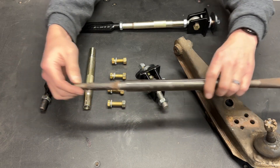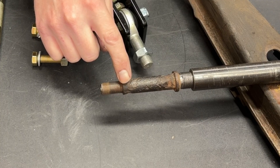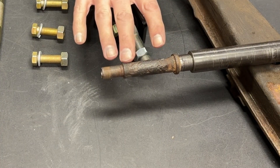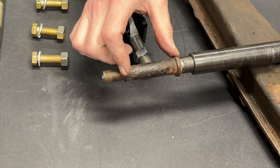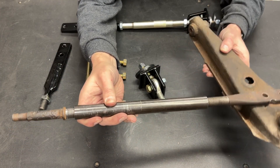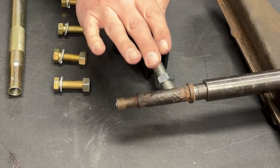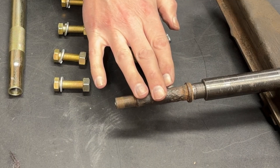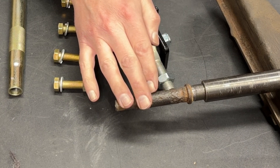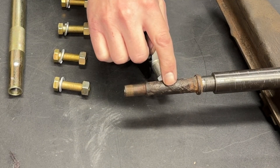The way this works is pretty simple: it bolts solidly to one end, and the other end has a machined surface that normally doesn't look so bad — this strut rod was totally wasted when taken out of the vehicle. Normally you have two bushings that sandwich a hole in the frame, and as the control arm moves up and down, you have flex at the bushing end. That in itself is not a bad design — the rubber bushings prevent road vibration and noise from translating into the car, and handling-wise there's not a lot of slop. It's a decent way to do it.